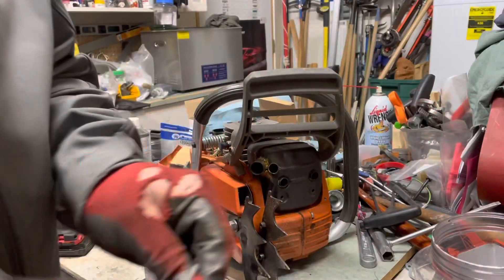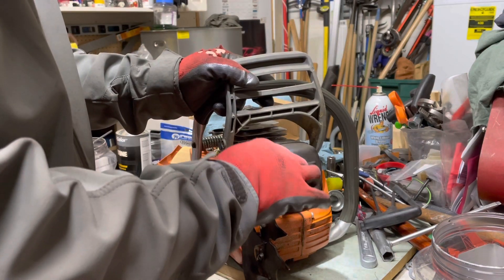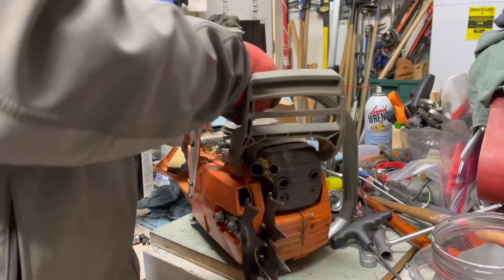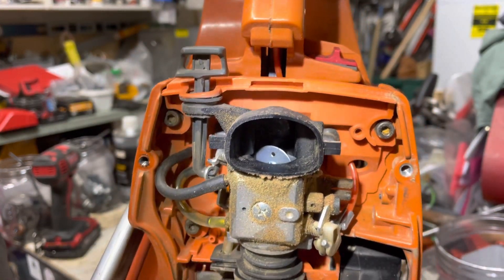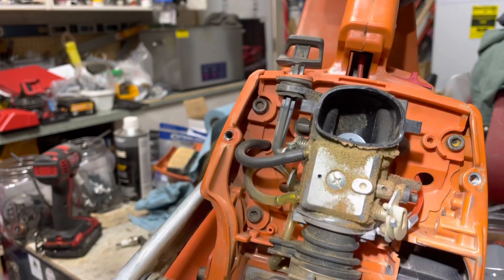Going through this quickly, see how fast I can take this thing apart. The muffler's a little loose — probably should put a brace under there. Also, if you can kind of see in there, the filter wasn't doing it justice — sucking fines. I can already see scoring in the piston, so let's go ahead and take this off and see what else transpires.